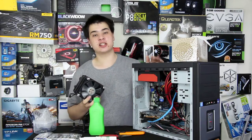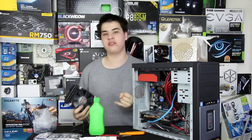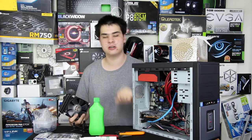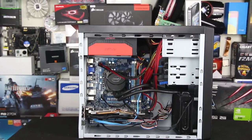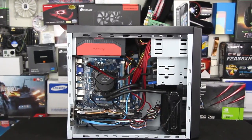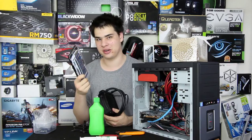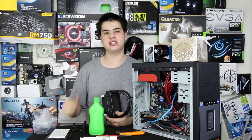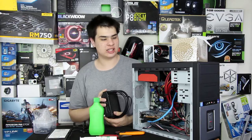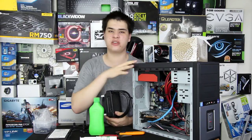If the test boot was successful, shut down by pulling the power, then reinstall the graphics card and RAID card. Before putting the side panel back on, do a full boot into Windows to confirm everything is working — it seems like something always goes wrong the moment you close up the case. Once you can get in and out of Windows fine, stick the side panel back on. A magnet can help if you tend to drop screws, and take the opportunity to do some cable management while you're in there.